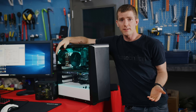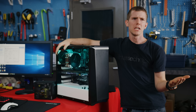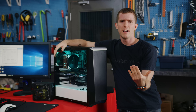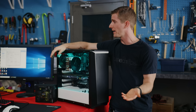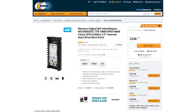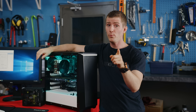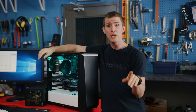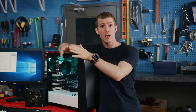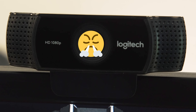There ended up being a few things that you can't overclock, like your SSD or your hard drive. If you've got a 7200 RPM disk, that's all she's got — the closest thing would be buying a faster drive like a WD VelociRaptor that spins at 10,000 RPM, but even that is much slower than an SSD. We also tried pretty hard to get the webcam overclocked — and while it's technically possible to increase the FPS while decreasing the resolution, our Logitech unit just wouldn't play ball.